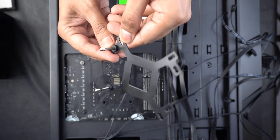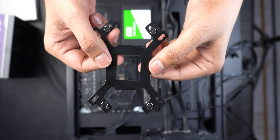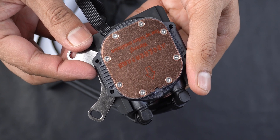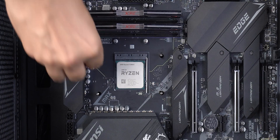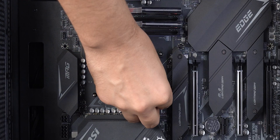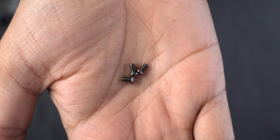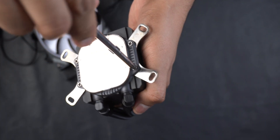On the common backplate, I installed the screws with their washers on the correct hole as shown on the manual page. Even if you skip the manual and just align the backplate on the holes, that can also work. But make sure you remove the sticker from the pump's copper base plate, otherwise you'd have no idea why it's not working. At the other end I inserted four plastic standoffs. These standoffs won't fit tightly until you put the pump over them and screw it in. Before placing the pump, you also have to screw in the brackets on the sides of the pump.